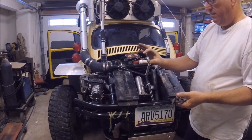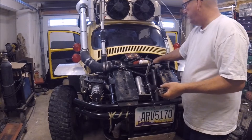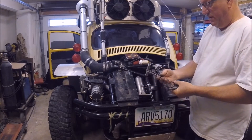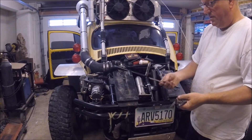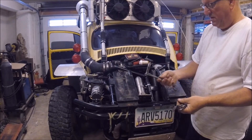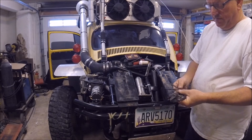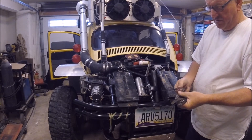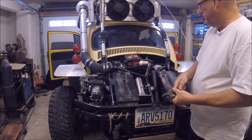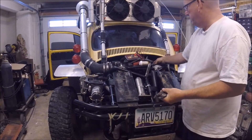These are my CV bolts — I use an Allen head, it's just what I prefer. Here's another thing I've learned to carry: a cheap little Harbor Freight file kit. I've rebuilt threads on bolts and tie rod ends. When your CV explodes sometimes it mars the splines on the axle. You've got plenty of time when you're broke, so I've seen people take the time to file it down, repair their car, and continue moving down the road instead of making a big ordeal out of getting them out.